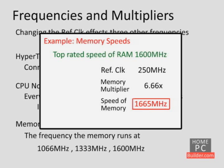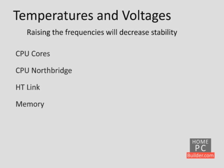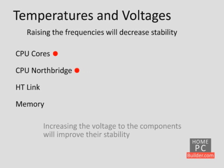This could result in overclocking these components to the point where they cause the system to be unstable before the CPU can reach its maximum overclock. Fortunately, each of these components has its own multiplier that we can set. We will lower these multipliers so the HT link, CPU NB, and memory frequencies stay within their limits. As we individually raise the frequency of the CPU, CPU North Bridge, HT link, and memory, they will eventually reach a point where one or more components becomes unstable. To combat this instability, we will increase the voltage to the components as needed. The increased voltage will help stabilize the components.